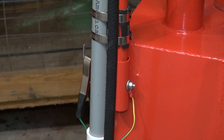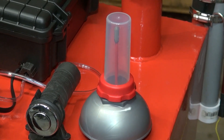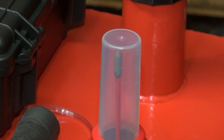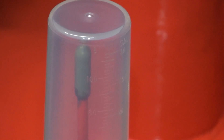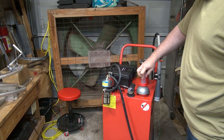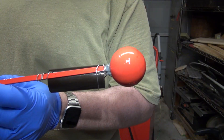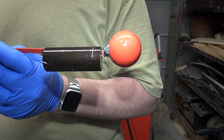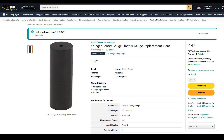Over here the fuel indicator mechanism didn't work right. First off, the shaft on it was too long, such that anything other than a completely empty tank would make the indicator impact the top of the gauge, so that had to be trimmed down, and I added a cap onto it to make it easier to see. After testing, the float bulb was either filled with fuel and sank, or didn't have enough buoyancy to raise the mechanism. I drilled a hole in it to drain any accumulated fuel and then sealed it with JB Weld, and since it still didn't float, I purchased and attached another float to it with some stainless steel wire, which finally allowed it to function correctly.